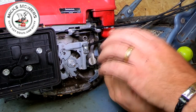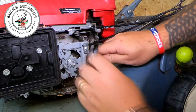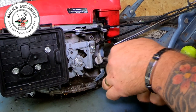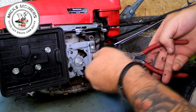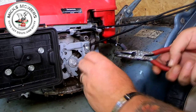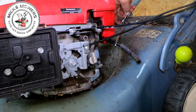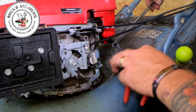Give your fuel line a little tiny twist first, and then you should be able to just pull that straight out. You might want a bit of leverage just to help it on its way. Don't break the fuel tap though — it can be a bit tricky and troublesome. Right, fuel is now off, and that should stem flow with my hemostats on there. I'm going to move that fuel line out of the way.